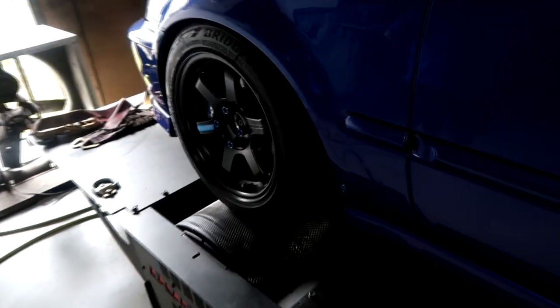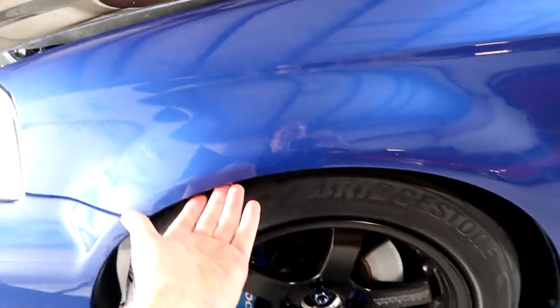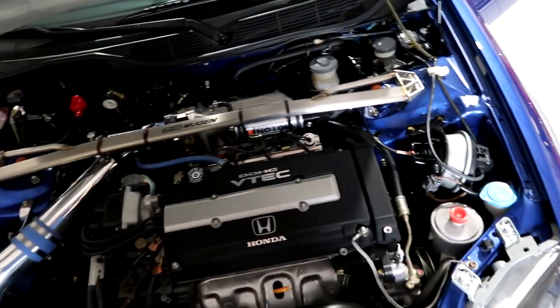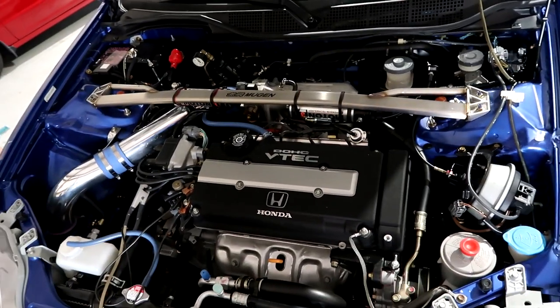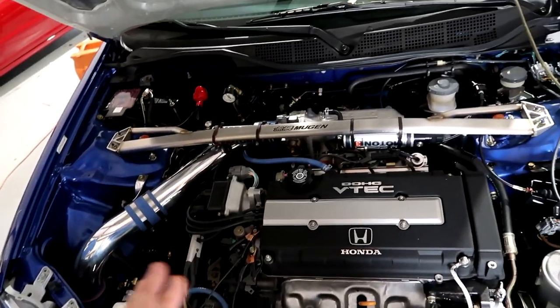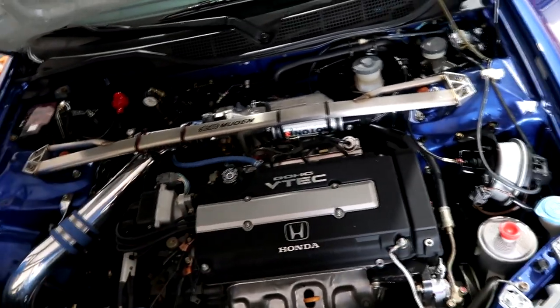I'll be honest, I haven't followed his channel - I'm too busy doing what we do. It looks like the fenders have been rolled, so maybe somebody's tried to roll them and kink them a little bit. It's one of those things you have to massage - you can't bend the fenders, you have to creep up on them very, very gradually. Some are going to say it's a shame to take this motor out, but this car is so much better with a little bit more power, and the fact that it unbolts and bolts back in with no permanent change - it's like it never happened.